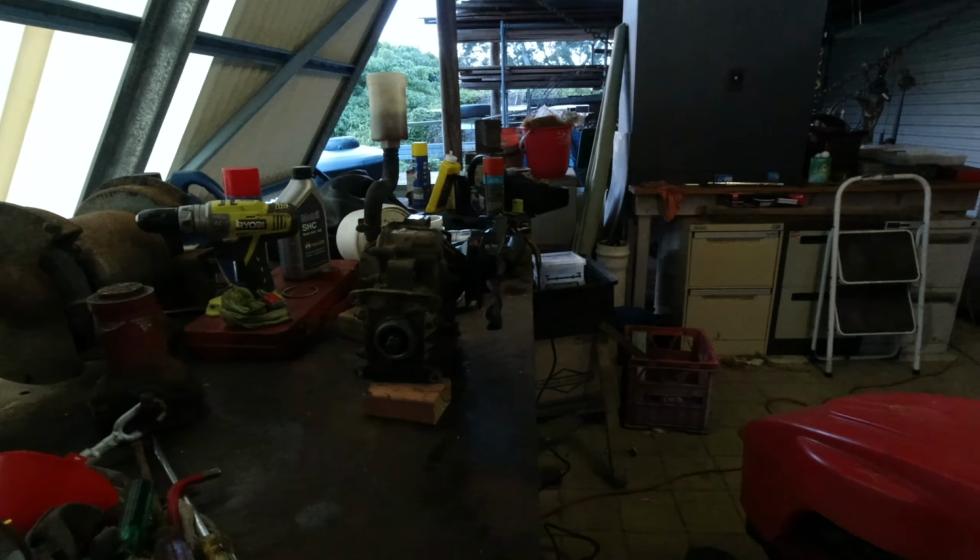I do want to be able to go through at full speed though, and it seems to be able to. The book says you're supposed to go in low range, and you're not supposed to use a front end loader digging in anything but low range. It's not good for the hydrostat. Might be able to do it, but it's not good for it.